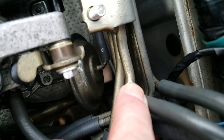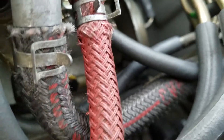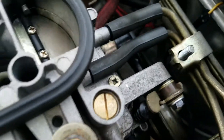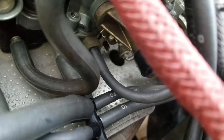Next we have the green one which comes right off and connects there. The yellow right next to it, and the one just under those two connects right there — pretty clear cut and obvious. Then we have these two hoses that connect here on that gang — the metal one — the top one connects right here, the lower of those two connects right down there at the base of the carb.